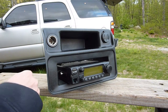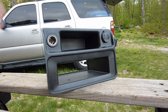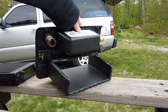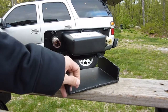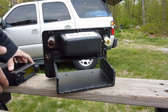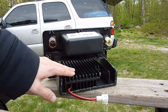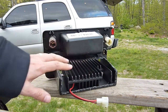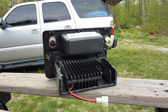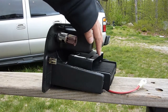Here's a look at the bezel with the radio sitting in it out in the daylight where things are a little more visible. Let me take that out — here's the back where I modified it. I haven't deburred it yet; I will do that before I mount the radio. With the top of the tray removed, there should be plenty of room for the heat to escape into the dash area. Not ideal, but better than having the plastic smooshed right up against the radio.